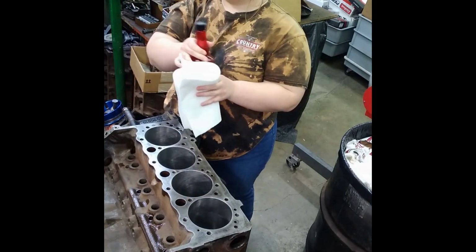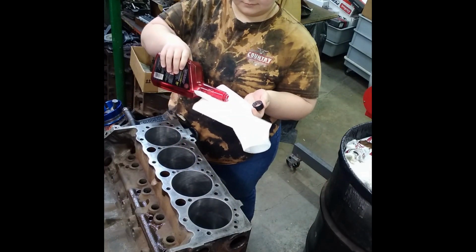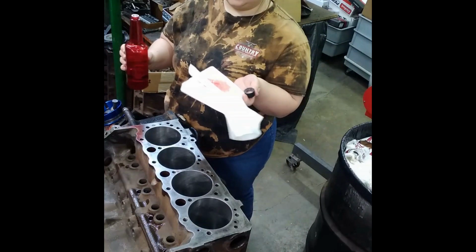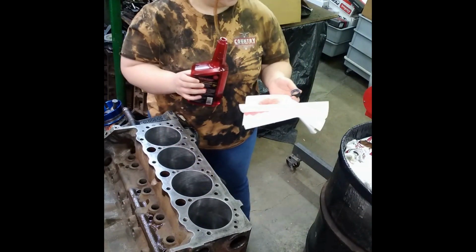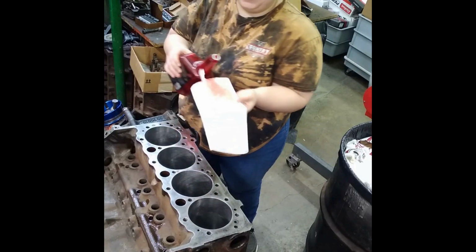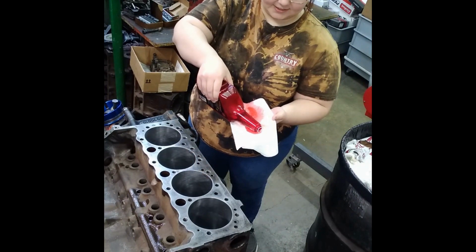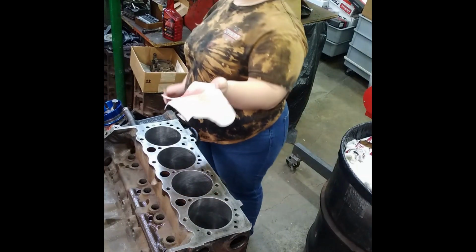Now, like I did on the other side, she's going to put a little Marvel Mystery Oil in. You're going to need more than that. More? A liberal amount. Is that good? Looks like Kool-Aid. More than that. Really? Yeah. Here, take the lid. I don't want to use too much of it. You got to get them cylinders wet, girl. Is that good? Yeah, for now. And then you're going to do a couple cylinders. You have to pour a little more on there.